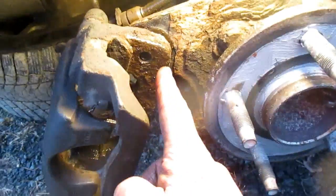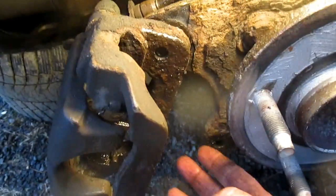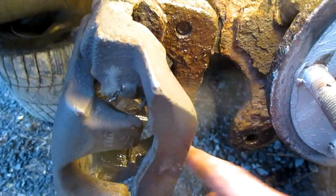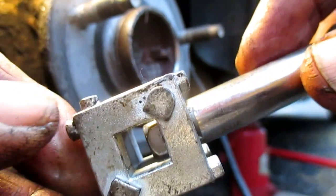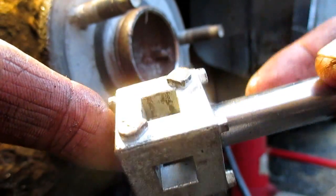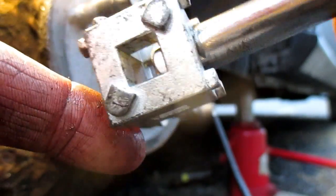What I usually do is I'll remove the caliper mounting bolts, as you can see here, and then I'll move the caliper out this way just so I can access everything a little easier. Put the extension on it and you just put it in the opposite side of the one you're going to use. This is the one we said we were going to use, so that will go in against the plunger, and then we're going to turn it clockwise — righty-tighty — to get the plunger into the caliper.